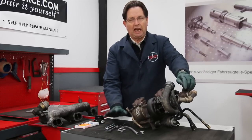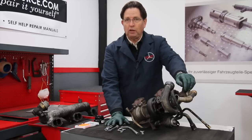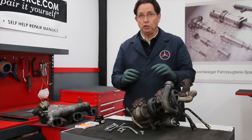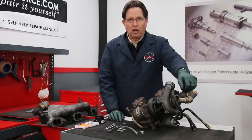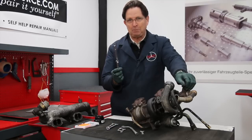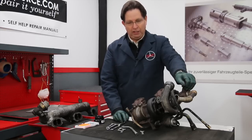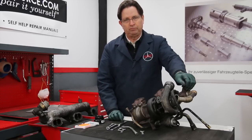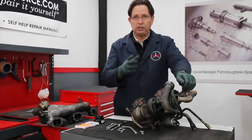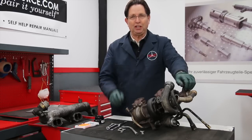The tool kit comes as an add-on because not everybody wants it. It does not come with instructions on its own — it's meant to be part of the entire kit, where the instructions for using these tools are included with the turbocharger center section overhaul guide. Keep in mind these are not snap-on grade tools; they're not meant to be, and they're not priced that way. So be careful — if the bolts won't loosen, don't force them with this tool kit. Approach the job with caution, use common sense, have penetrant and heat handy, and you should be successful.